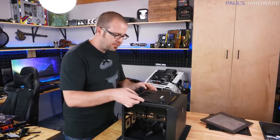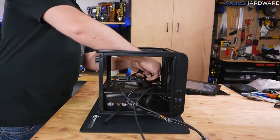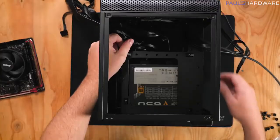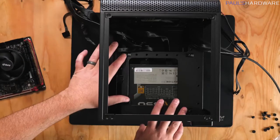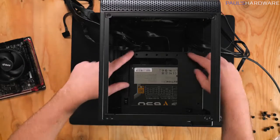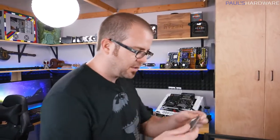I've reinstalled the bottom piece and routed all the cables up so I can see what's what. At the bottom of the case is where your motherboard will go — there are four mounting points for this Mini-ITX build. If you're using a larger micro-ATX or full-size ATX case, you might have five, six, seven, eight, or nine standoff points. Make sure you have standoffs — the raised mounting points — and do not mount the motherboard directly to the case. Forgetting standoffs is something you definitely want to avoid because it can damage your hardware.